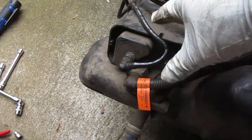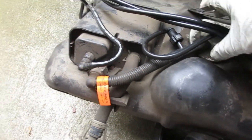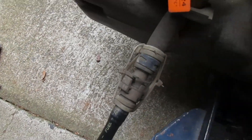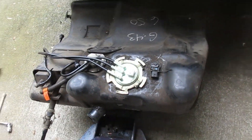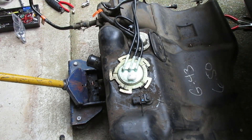The manufacturer actually includes a little handle on the tank in case you need it. This is what we're after — the fuel pump. As you can see, it was plugged in here, and the other plug is the fuel tank pressure sensor. The rest of this is emissions-related — there's a charcoal canister here, and what's probably the regulator as well. Now let's get the new fuel pump ready. We'll need the chisel — or a screwdriver if you don't have one, though a chisel works better — and a hammer.